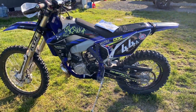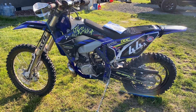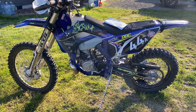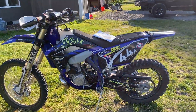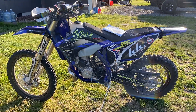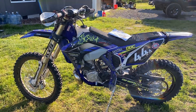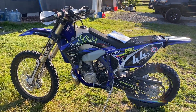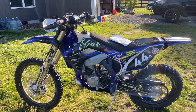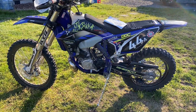Out of five — review: five out of five. It caught up. I put it on, didn't touch it, fired it up — boom — that's like two and a half stars right there. Immediate power increase, even though I jetted the hell out of my Keihin and couldn't figure out what I wanted. Easy to tune — took me 15 minutes after getting it hot to mess around. It's nearly perfect, just gotta adjust my idle. I might detune it just a little bit because that thing is wicked now.